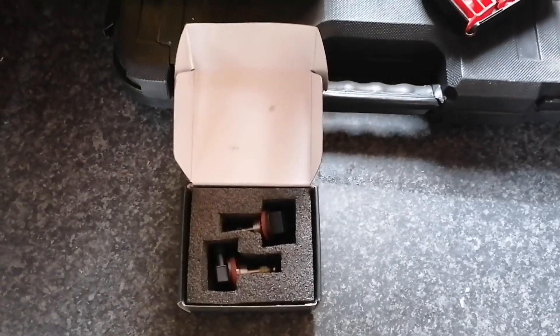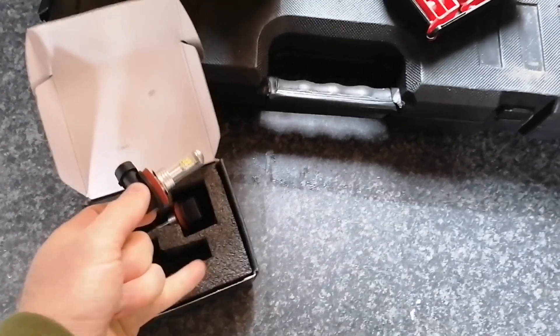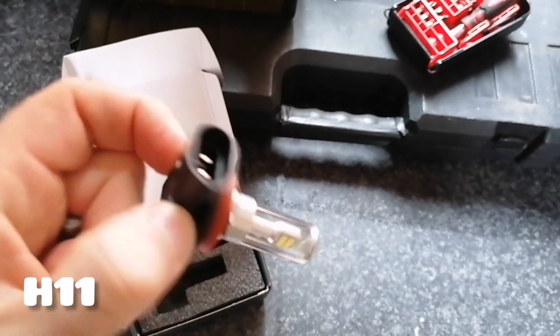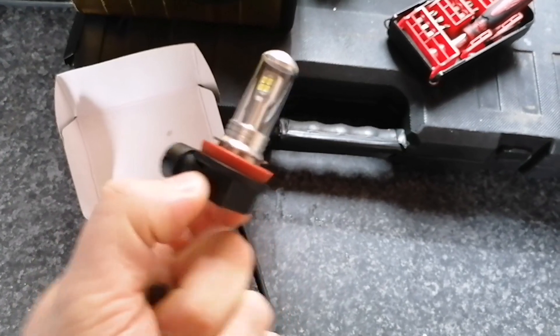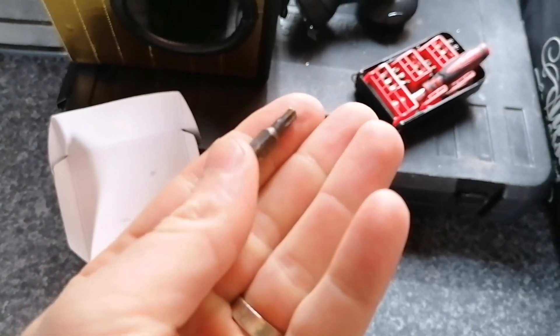Just before we head outside, I'm going to show you exactly what we've got. It's all well packaged and well protected in there with foam, but these are OEM fitment — push-in, same connectors as you get on standard. There's the LED bulb, and what you're going to need is a Torx bit — it's a T25. I'm going to turn the fog lights on now and show you what the OEM yellowy bulb looks like, and then we'll swap it over. The LED is obviously going to be a much brighter, crisper beam of light, and it should match the LED sidelights and the xenon headlights.